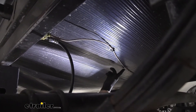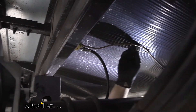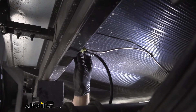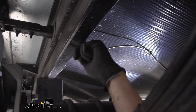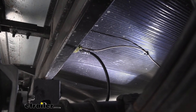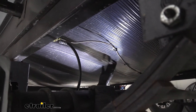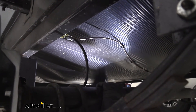As you can see, we have a couple of zip ties used to secure our brake line to this bottom panel here. We made a little kink in our line because we had a little bit of extra length, but it wasn't enough to justify flaring it — so we went ahead and just attached it once bent to the block, which has our other two fittings attached to it as well. The final fitting in this block is going to be for our longer line from the kit, which is going to run to the front of the trailer into our actuator. Keep in mind, if you don't want to run the brake line under the panel, you can undo some of these fasteners and run it above — however, that is going to take quite a bit longer.